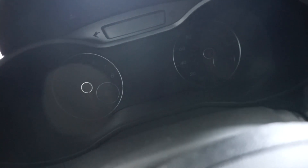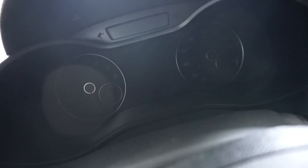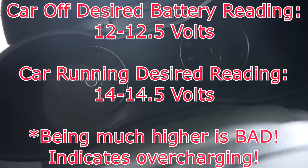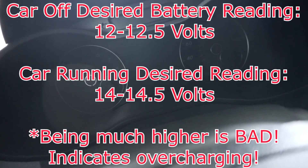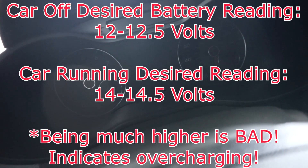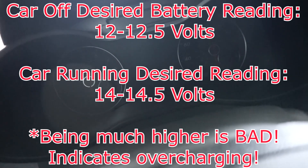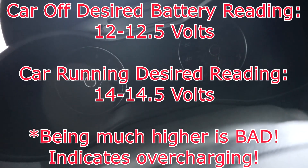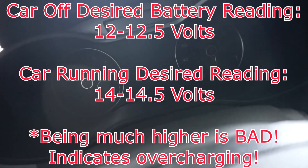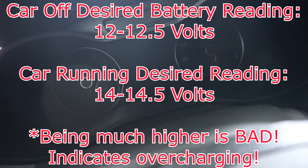Big disclaimer: by making this video, I found out that my voltmeter is no longer doing its job. It was giving me readings below where they should be on three separate cars, all of which have healthy batteries — one of which had a new battery. A healthy reading for a healthy battery should be around 12 to 12.5 volts. You'd get closer to 12.5 if you had just run the car and obviously for newer batteries. You'd get lower toward the 12s when you've had the battery for a while — it doesn't mean it's bad, it's just obviously slowly degrading. That's what a healthy reading should be.